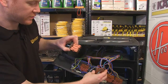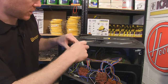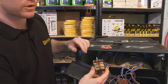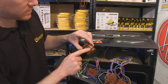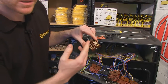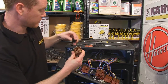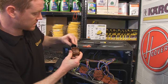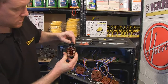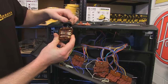That's my new selector switch fitted to the cooker. Using the old selector switch, I'll demonstrate what can happen to these. Fat and grease can fall through into the cooker from the hob top and find itself between these contacts here. If you see that these are burnt out, that means the selector switch has failed because of the grease and fat that's fallen through. If you put a knob on the end of the shaft here, you can see that these contacts move freely — so this selector switch is working fine.